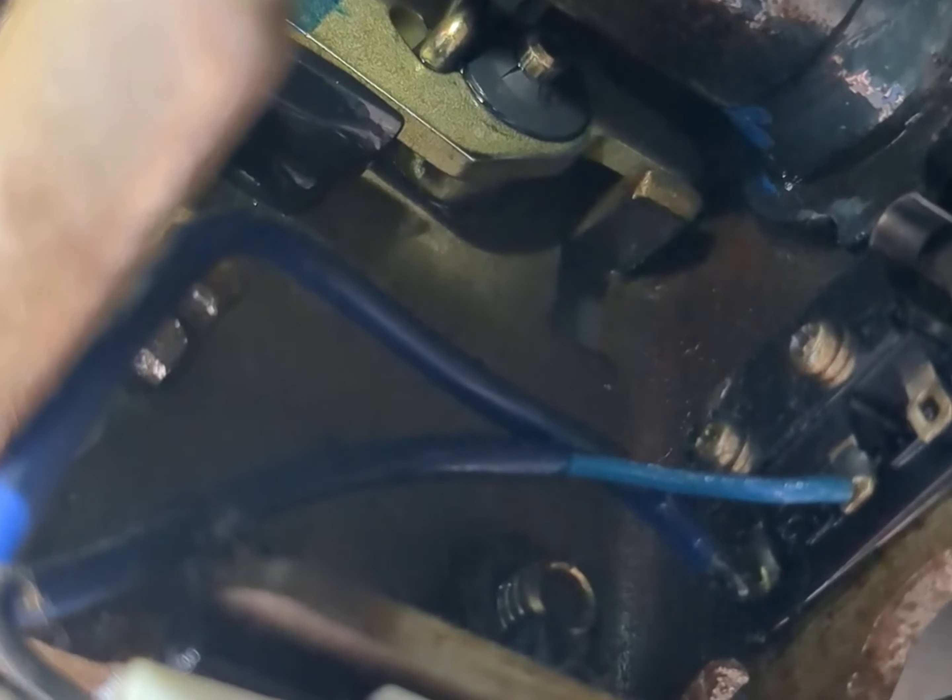I lubricated it and I've run it out a bunch of times — dozens of times — and it didn't prevent me from shifting out of park. It did hang down too low, remaining disengaged excessively, twice out of roughly a hundred tries, but I'm not really worried about that. So that's my temporary — maybe permanent — solution. You've got your shift lever which pushes in, and without pressing the brake that pin doesn't drop. That pin engages the cam, which stays in the way and gets out of the way when disengaged, allowing the lever to go past that nub.